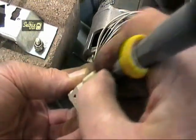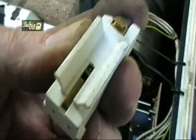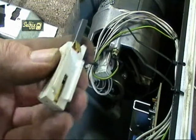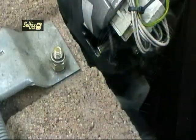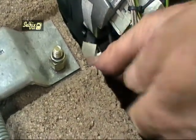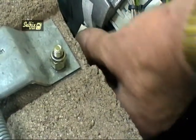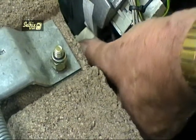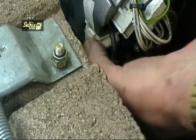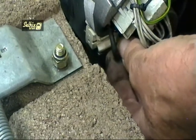When you take the brush assembly out of the bag, the brushes should be held inside a plastic housing to prevent them getting broken. You'll have to lever up a small brass tag that holds them in place. If you put your finger over the end, it will prevent the brush from shooting out when the tag's been lifted. Be extra careful when locating the brush into the motor casing, or you could snap it. You might consider holding the brush inside the housing with your finger until it's seated in the casing, but if you take your time, it will fit without too much trouble. When it is fitted, make sure it's pushed all the way in so it locks, and don't forget to refit the wire.